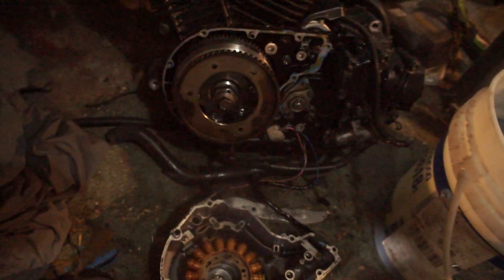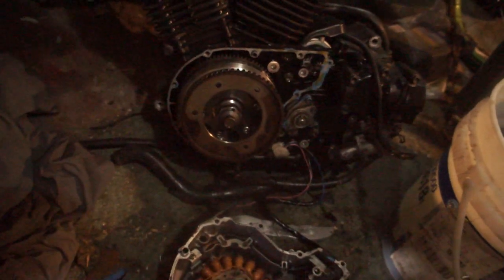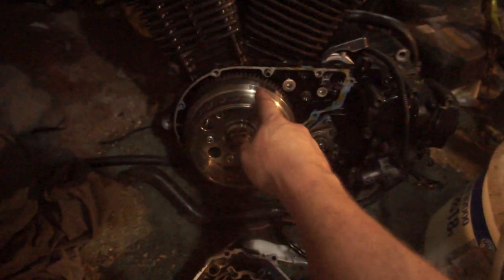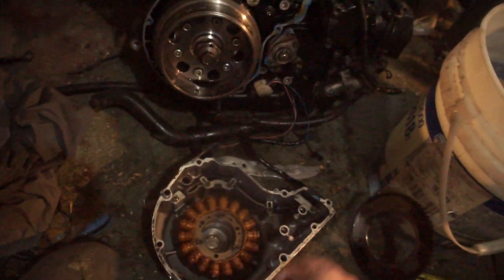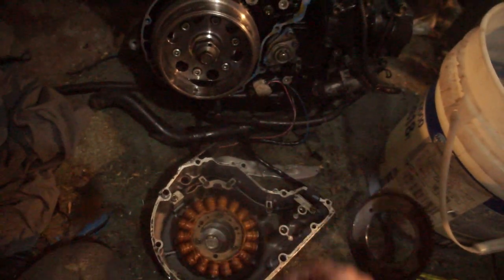So, anyway, might make some progress. Let's find the right sensor and whatnot. If it was a little bit smaller, could get this machined down and put this wheel right where the original teeth were, and then just get a VR conditioner board like MegaSquirt and Speeduino use. I don't know. Anyway.